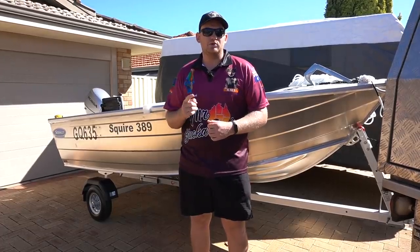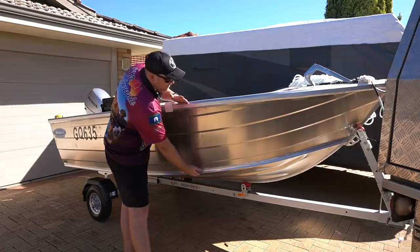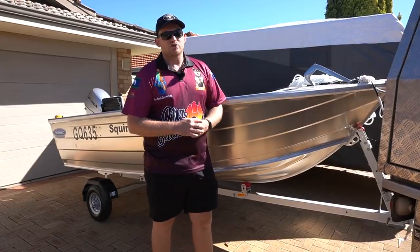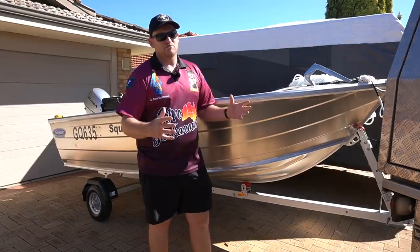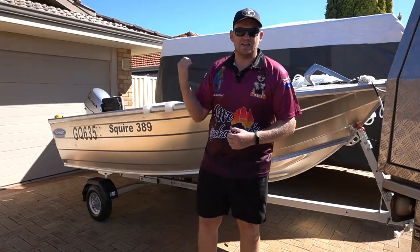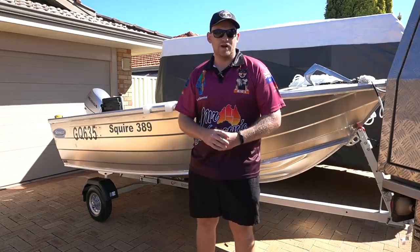Firstly, we want to be able to launch it off the beach and do some inshore fishing. This means I need a decent amount of freeboard. Freeboard is how much of the hull sticks out of the water. A bigger boat with more freeboard is going to behave better in the chop, and I also want to be able to take Tiff and Chloe with me, so again I'm looking at something bigger so it's more stable and more safe. Finally, a lot of the coastline and the river systems across the top end of Australia where I want to take this thing is home to some pretty big crocs, so a bigger, stable boat with higher sides makes a lot of sense all around.